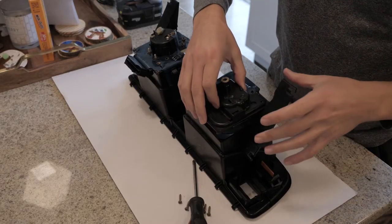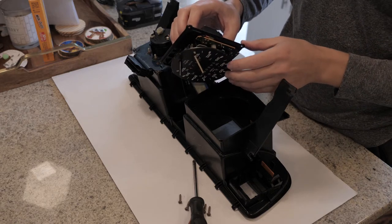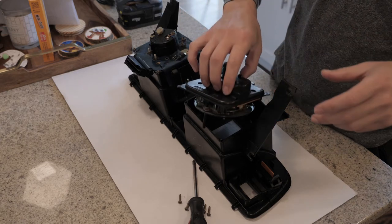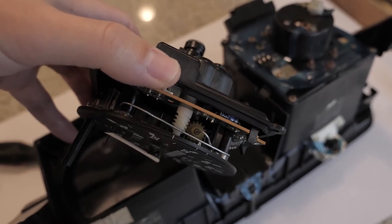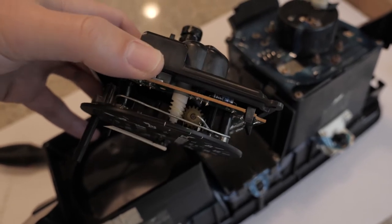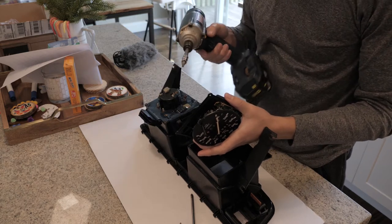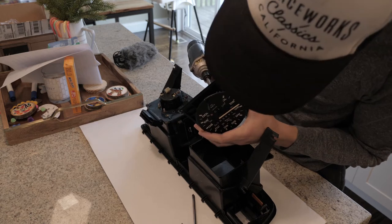Check this out — pull this open and basically the way the speedometer and odometer work is the speedo cable pops in here, spins around, and that spins a whole bunch of gears in this assembly. Normally what happens is these little gears come loose, causing the disconnect between the speedo cable and the odometer. It looks like someone's already been in here to address the issue — there's a little wire piece in here. I've got my makeshift speedo cable right here; I'll pop that in the back and speed it up.